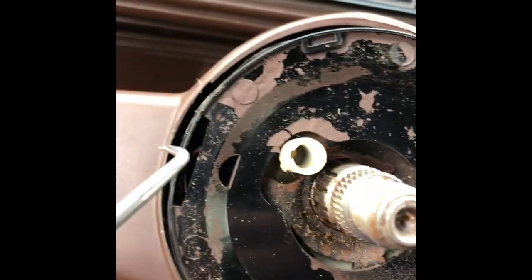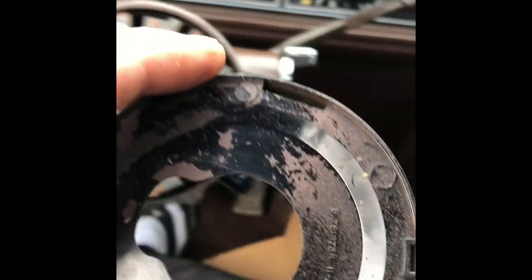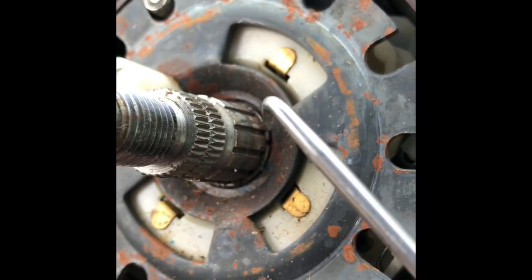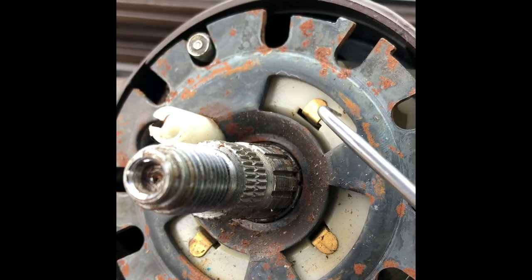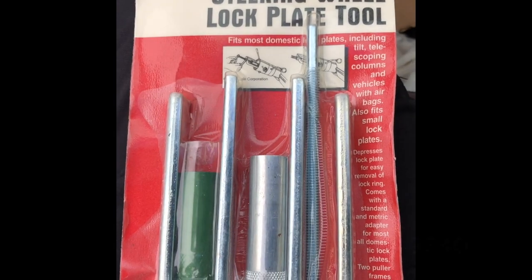For this little plastic cap, I just lightly pried on it — it popped off in one spot — then came up and did the same thing, just lightly pried it off. It does the same off the bottom and comes right off. Now if you look in there, there's a tiny little clip, and this metal plate has to be compressed down far enough for you to pull that clip off, and then you can pull the plate off to get to the turn signal switch. We'll see if this tool will do the trick.